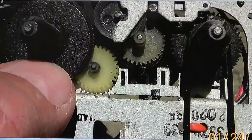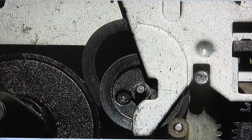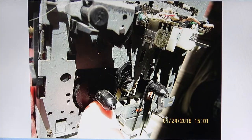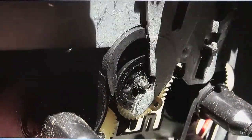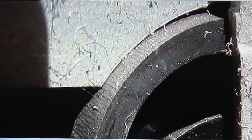Here I'm trying to remove the idler tire without bending any of this apparatus. Here's another view — I just wanted to show how thin this tire is. And here, if I zoom into it, you can see the dry rot that it has. These tires don't last forever — see the dry rot in that. That's what happens to all these tape decks.